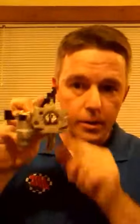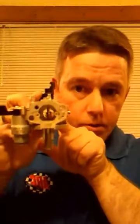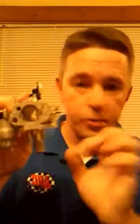And with my engines, it's very, very important because you're dealing with, most of the time you have to run a bored out stock carburetor. And when people talk about the size of the carburetor, a 615 or a 625 or a 675, they're talking about the venturi of the carburetor. If you look in there, you see the circle in the very center. That's the smallest part of the carb. That's the venturi. That's where the air goes through the carburetor.